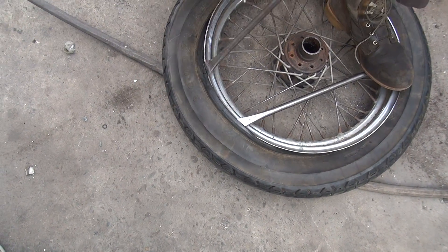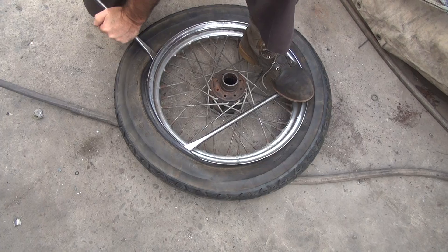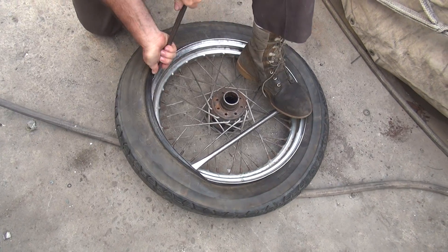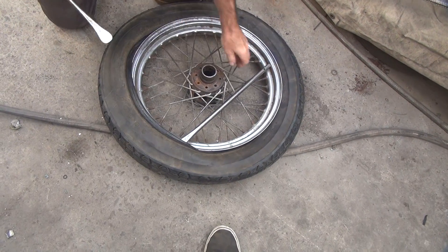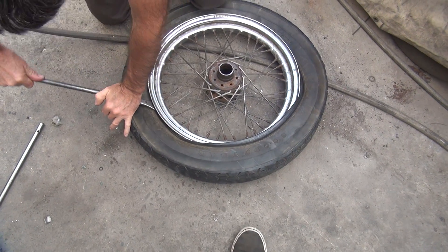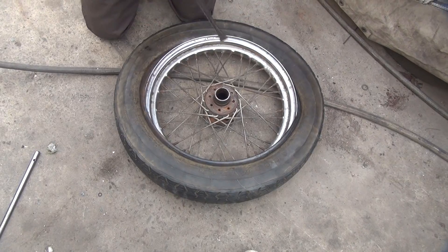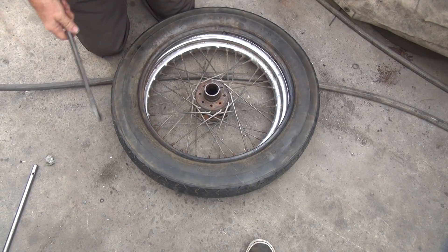This is a good tire — it'll be flinging up and hitting you, so you put your foot there jamming it and go like that. Notice I'm only going in this far, not going in too deep. Once you're that far, you can take the iron out, spin it around, and take bigger bites. See the inner tube in there — I'm not pinching it. No pinchy pinchy. You can, but I don't. I do the roll — you've got to do the roll.